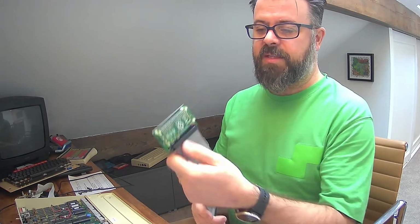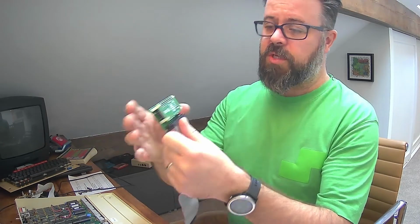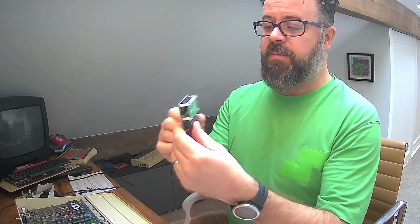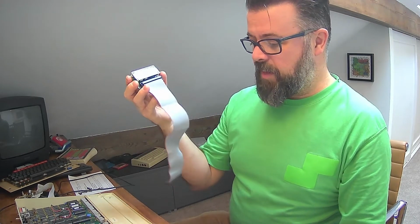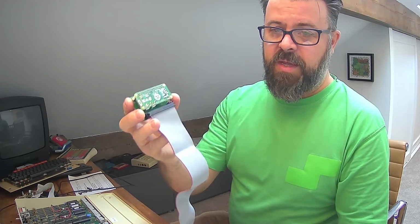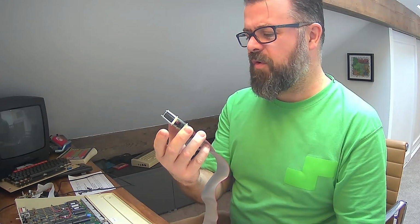You could get ones that would link up to, what's it called? Not Minitel, Prestel is it? So you could actually dial up to almost BBS type services, modems, these sort of things. But this will emulate a lot of the different cores and second processors. So this can be a Z80 processor. You can have a second Z80 processor. It can be a second 6502 processor. It can also be a second 6502 processor running at quite a high speed as well, something like 300 to 400 megahertz.